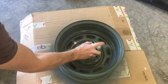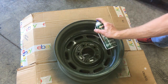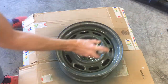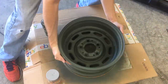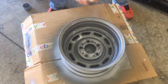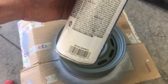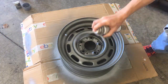It's been about 15 minutes, time for a second coat. And done with the back. I'll let this dry and do the same on the front. I'm using Duplicolor's wheel coating — this is the graphite, which is like a dark silver. I've always had good luck with this stuff, and I'll have a link in the description.